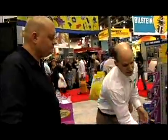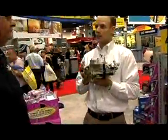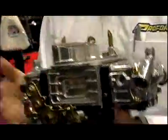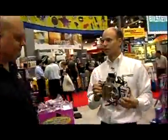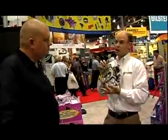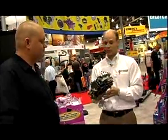Cool. Now, in addition to that, we have our popular Street Series. And just like all the rest of our carburetors, it's full of all the same great value. You get the billet everything, die cast this, that, aluminum main body. It's an electric choke. Yep, you've got the electric choke. And this comes in 600, 650, all the way up to 850, and also has vacuum secondary models too. So that's the Street Series right there.